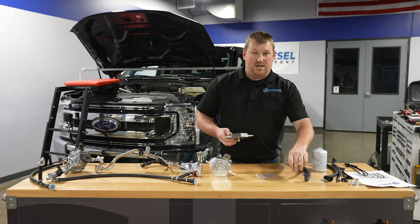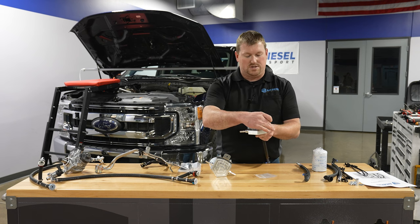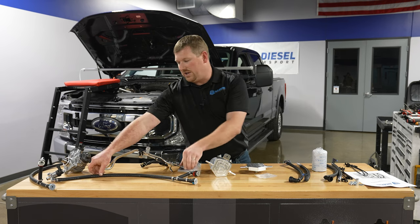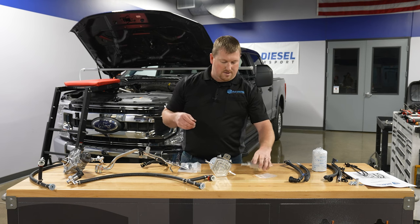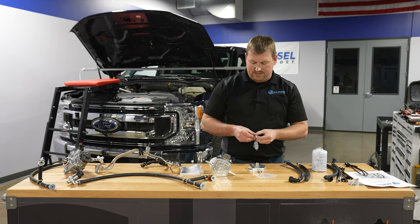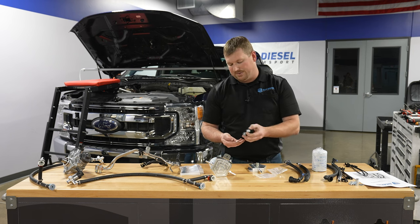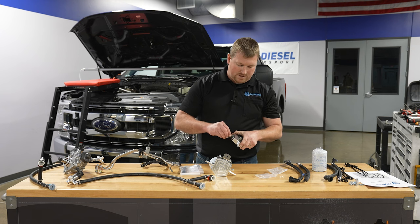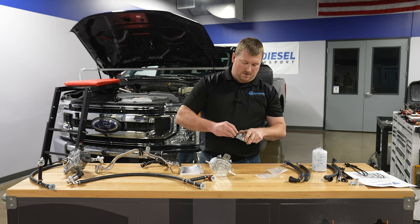On these quick connects, they have two O-rings inside that seal, so you don't want to damage the sealing surface on these fittings. You could also blow out the return hoses, but the main hose is this feed hose going to the pump because it's downstream of the factory filter. We pretty well have our filter head pulled together with fittings in. We need to put our isolators in — these help prevent vibration from being transmitted back into the vehicle. Thread those in; they just need to be hand tight and will bottom out against the filter head.